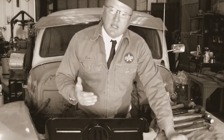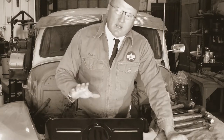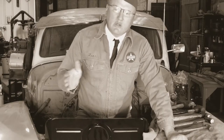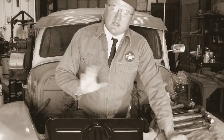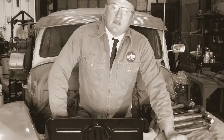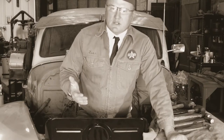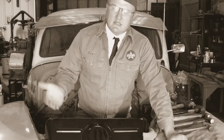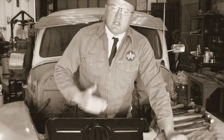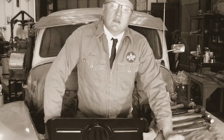When things overheat, you're burning the clutch on that flywheel, it'll heat up the flywheel and turn it gold, straw color, then blue, purple. That wasn't there. It had not been overheated. It was just fine. Now, if you've never done this before, this is your first time, you don't know what to look for, by all means, take it and get it resurfaced. There's also a logistical problem there for me because I'm a couple hours from the nearest machinist.